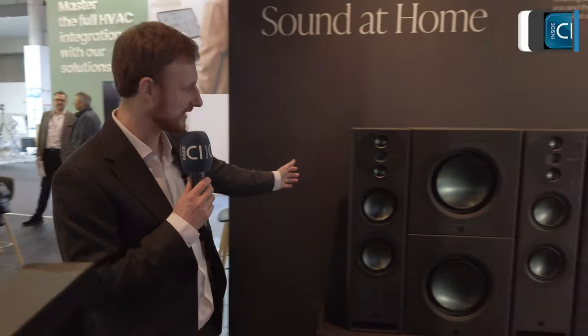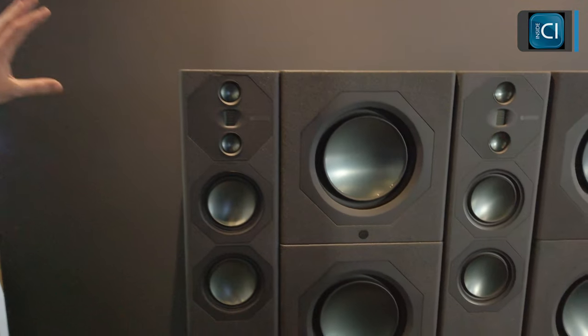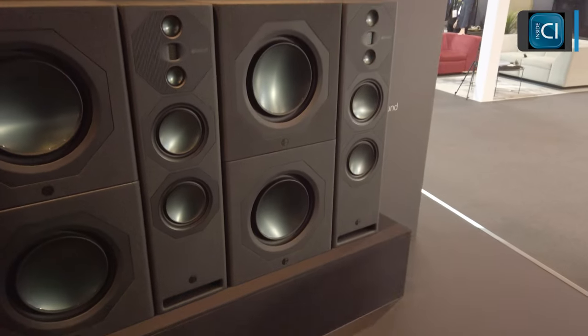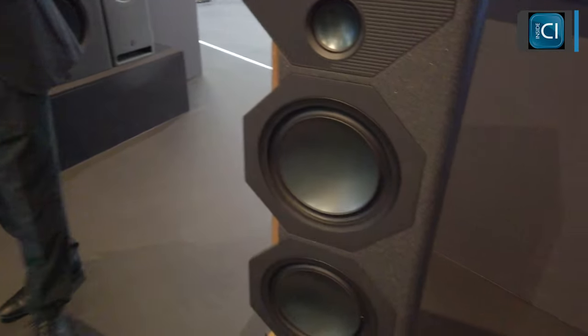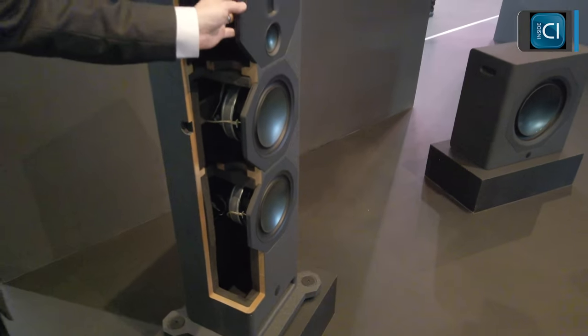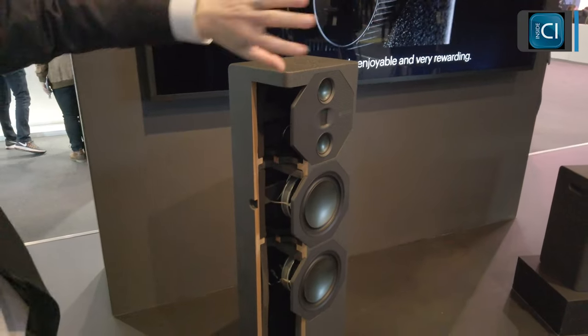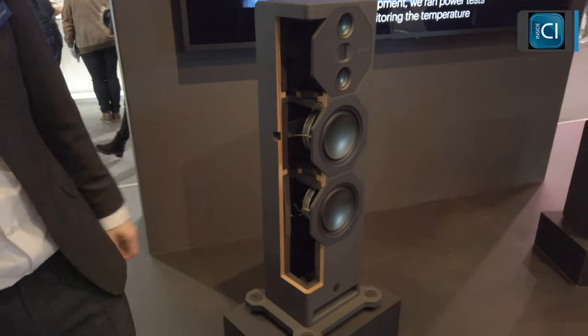Just at the end here, this is what we call the wall of sound. It might not be used by very many people, but it's a visual demonstration of what can be done with Synergy. We've got a cutout of a C300 so you can see what's going on behind. One last thing — each of the speakers with the mid-pod can have that mid-pod rotated. So you can lay the C200 on its side and use it as a centre channel if you don't want to put it behind the screen. With the C300, you can move the mid-pod to the middle should the speaker be lifted up high, to keep that tweeter level at the right ear height in the installation.